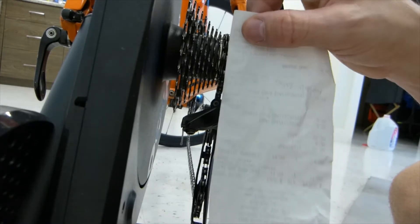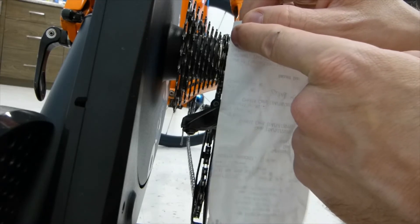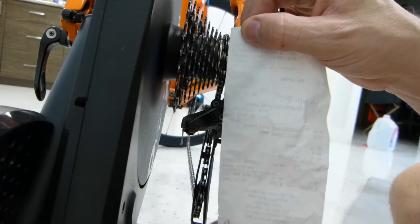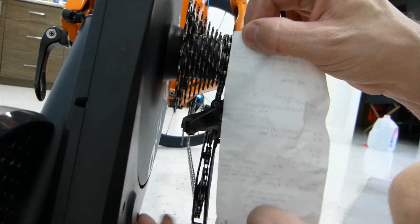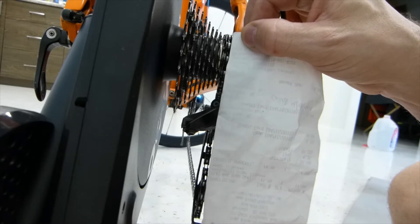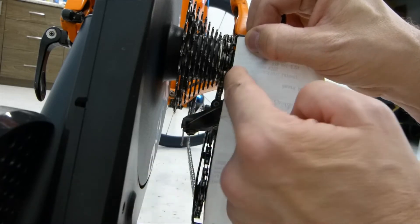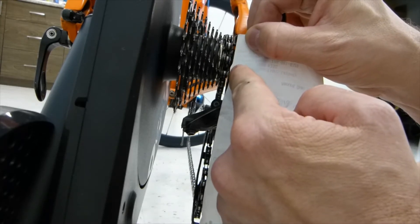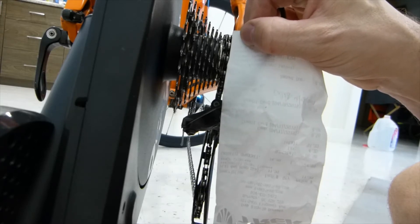With a piece of paper you can check it. If you line up the edge of the paper, center line up top, center line there — you can see that the derailleur needs to be there. That's why the derailleur hanger is bent a little bit. If I line up the edge of the paper with the derailleur, you can see up top here it doesn't line up at the top of the sprocket. It may line up at the bottom of the sprocket, but that's not good enough — it needs to line up with the whole sprocket.